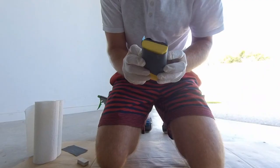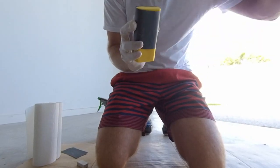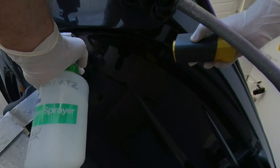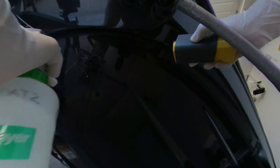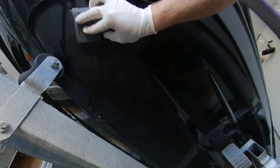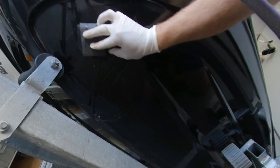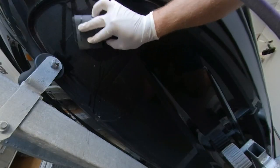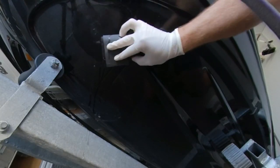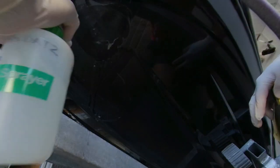completely fill the void. To ensure each layer of flow coat adheres to one another, you need to remove the wax surface layer. This is done by re-sanding and cleaning with acetone before applying the next layer. I used 400 grit wet dry sandpaper between coats. Wet dry sandpaper is waterproof, which allows you to use it with water, which acts as a lubricant.